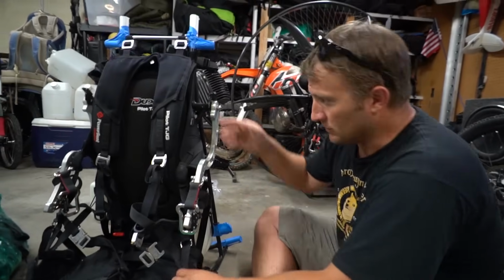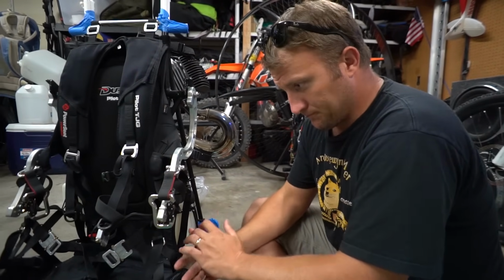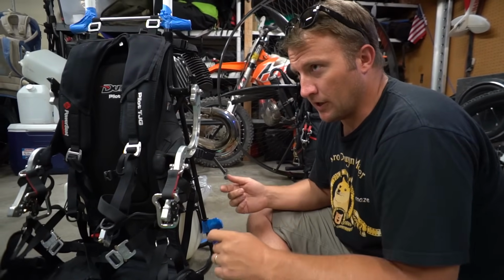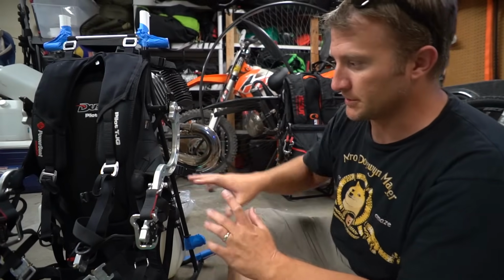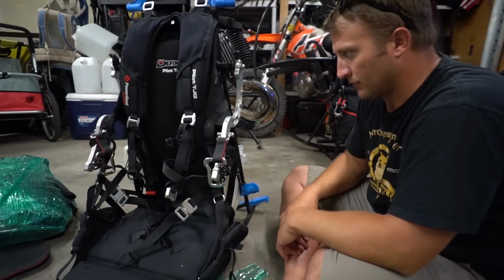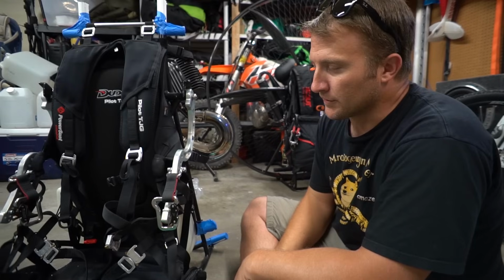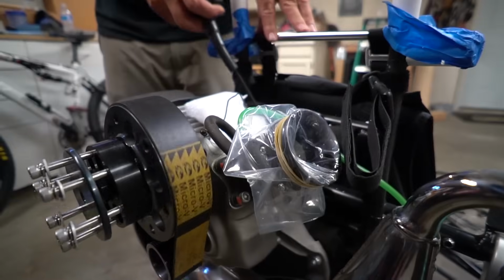But upon arrival, the first thing I check on a pre-flight of a paramotor, the most important thing to me, is not falling out of the motor. Next thing is things not falling off the motor, so that would be like the engine. But the first thing I'm checking is the suspension system, the straps, harness, the seat board, leg straps, the buckles, and condition, security of all that stuff. Next is crap flying off the motor, and then what's going to catch on fire. That's kind of my pre-flight down and dirty. Not falling out, stuff not falling off, and not catching on fire.